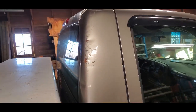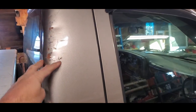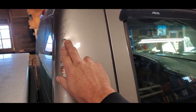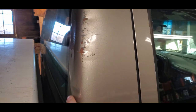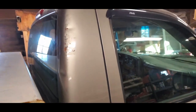Now I don't have my light set up. There's a reflective light that you put behind you so it'll cast lines on your workspace, and based on how the lines open up and pinch, it'll tell you what you need to work on for the metal. I started already here and I'm going to work on this a little bit more, and then we might get adventurous and work on this big guy here also. Not only is there a dent here and a dent here, this also has some damage. Worst case, I have smaller dents than the big ones that are already there.